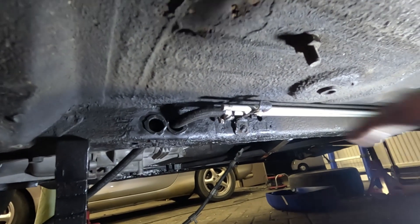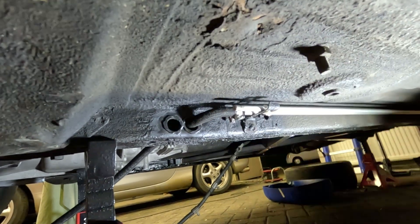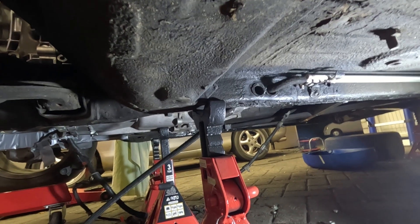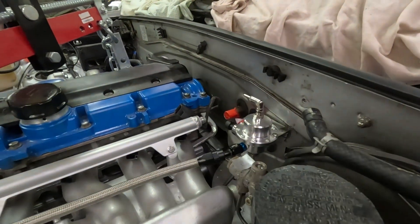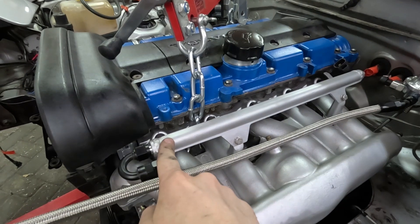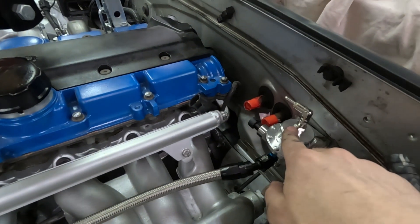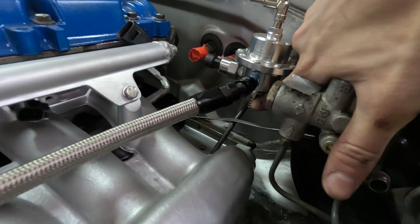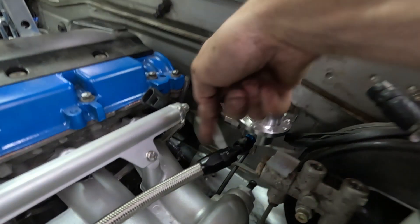Same with the front. Both lines come out right here where we made the little pipes in the frame rail, and that comes out the other side and tucks up just behind the subframe. That's where the lines go. The feed will go in here and pressurize the whole fuel rail, then return to the regulator which manages the pressure, and all of the excess fuel will be sent to the return on the bottom and go down as well.